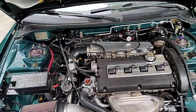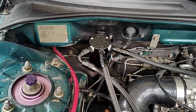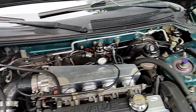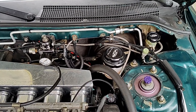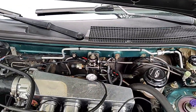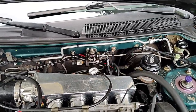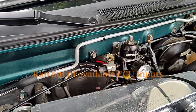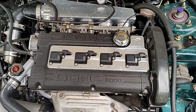I would definitely recommend measuring the size of your oil cooler before you do a project like that. Running a generic catch can — I think it's styled after Mishimoto but it's not; it's just a standard eBay catch can. Also running the Gen 3 Eclipse master cylinder, still running the factory clutch master, and a Fuelab regulator for fuel pressure control. I tried to run a fuel pressure gauge but couldn't quite get it to work properly — still working on that.